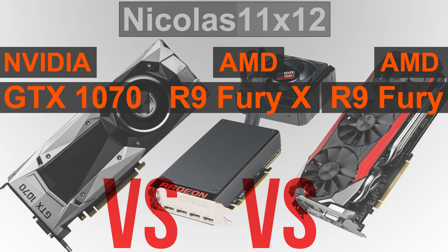The temperatures on the R9 Fury X as well as the Fury are very good. However, the R9 Fury is not actually the reference design — the Fury X is — but it features a closed-loop water cooler, which of course leads to those lower temperatures. The GTX 1070 I tested was a reference model, and therefore runs fairly hot compared to AMD's models.